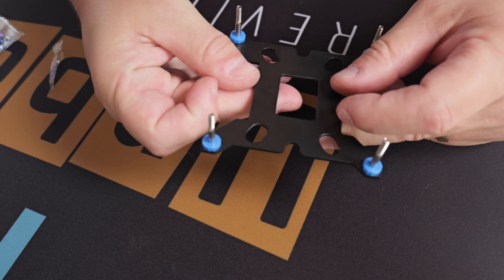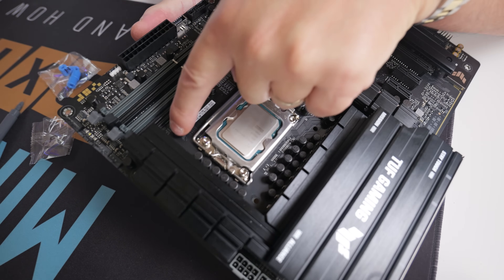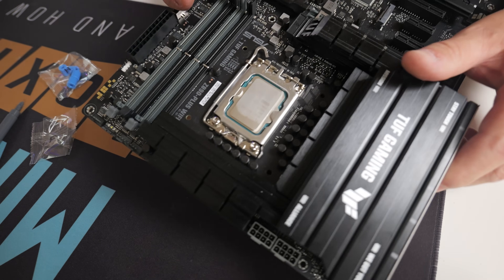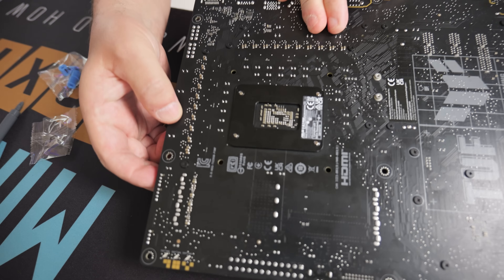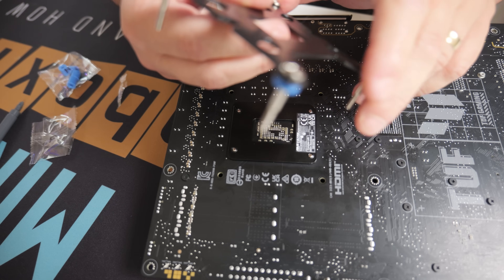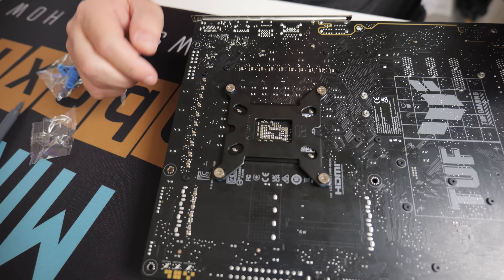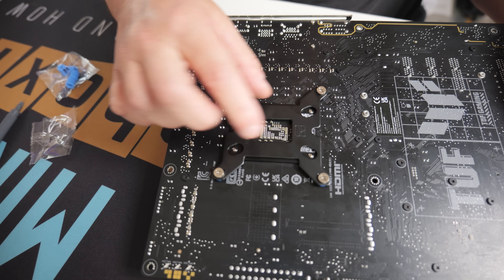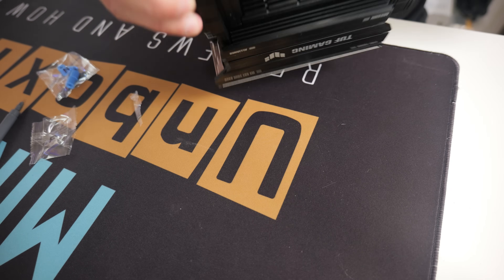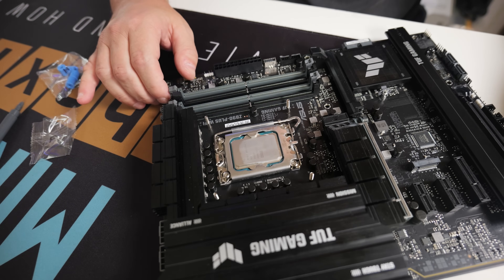The bracket is completed. What you want to do is put it underneath your motherboard. If we look at the motherboard, you'll notice there are four holes around the CPU socket and you want to drop the bracket through there. Turn the motherboard over and you can see the holes better. If you want to be neat about it, you can have the writing the right way up — it doesn't make a great deal of difference. Just line it up and let it fall through the holes, giving a little bit of space with the plastic protecting the motherboard. Hold it in place whilst twisting the motherboard over and you should see it's held in place.